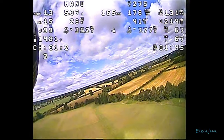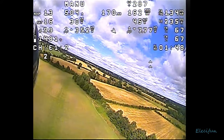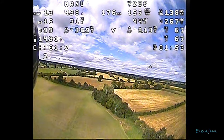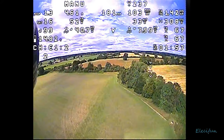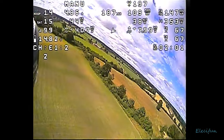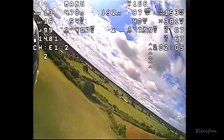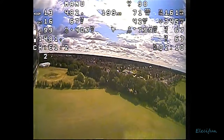The HDOP is what I like to call the link quality between the satellite and the satellite receiver. To the right side we've got our current draw - the amount of power we're drawing. I used 100% throttle when it went up and it drew 10 amps, and I ran about 67% throttle. When there's a lot of wind we're drawing around about five amps. The amount of milliamps drawn so far is 193-194 milliamps.